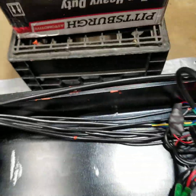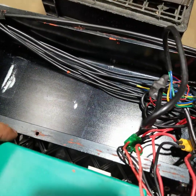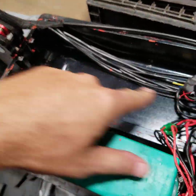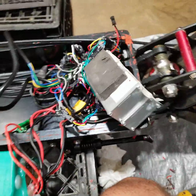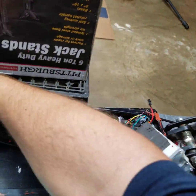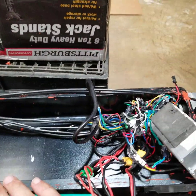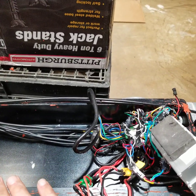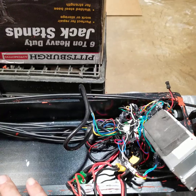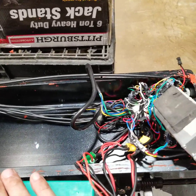There's actually a lot of empty space in here. I was talking to a manufacturer about getting a bigger battery, but apparently they can't make a bigger one to fit this space because it would need to go wider. Some scooters mount the controllers on the outside to free up more interior space. The largest battery the manufacturer could offer was a Samsung 24.5 amp hours for around $380, not including shipping — and that's only one additional amp hour, so it didn't seem worth it.